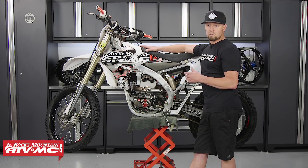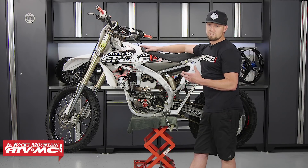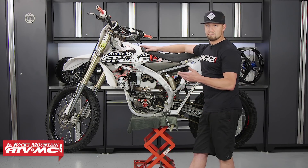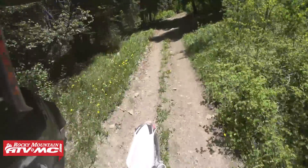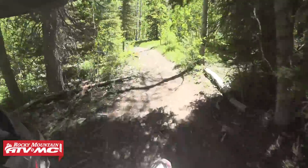A good sealed-up motor will contain most of it, but it's going to lose some. If you lose a certain amount — whether it be your head gaskets, your piston rings, valve sealing, or maybe a crack — that will give you a good indication of where to investigate next to see what's wrong with your motor.